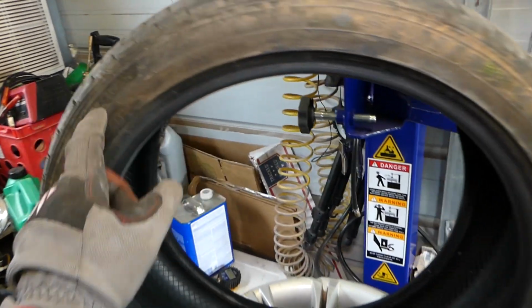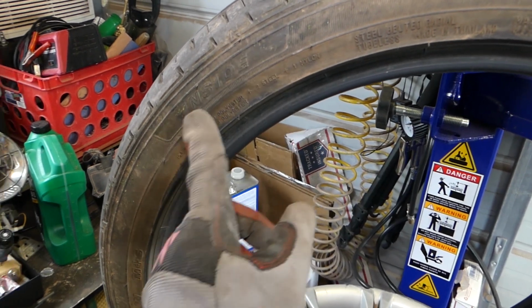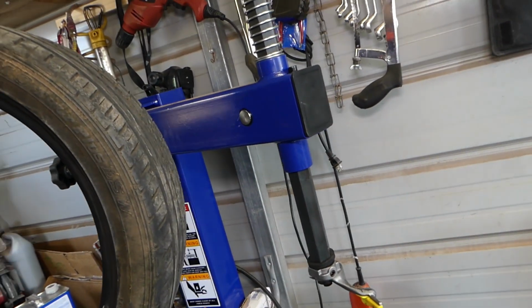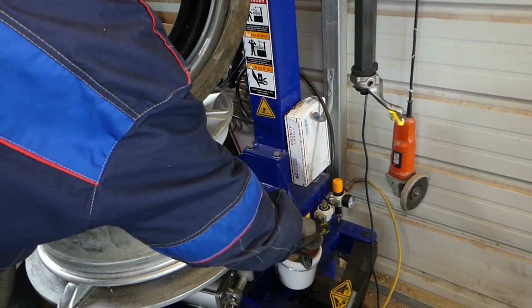Almost every tire has an inside and outside side. Some are reversible, but always make sure that you install them the correct way. This one says inside. So let's go ahead. We're going to get some tire solution now. You can find it listed in the description of the video below.